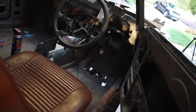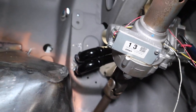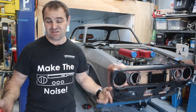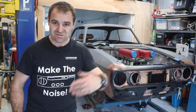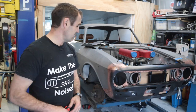We have our breathers going from the top of the tank in through the bulkhead connectors. They come in from behind the dash, go behind all the steering, and come out into the engine bay. I know there are a couple of people who were concerned last week that those lines were going through under the dash. You need to remember they're just breathers — they're just going to have vacuum and vapor. I would not want hot oil lines going through behind the dash of the car, but these I'm happy with.